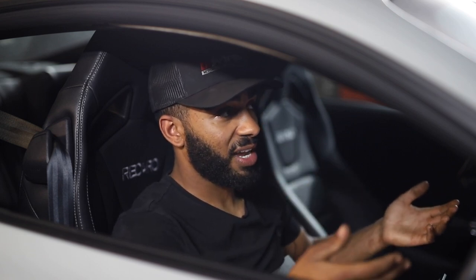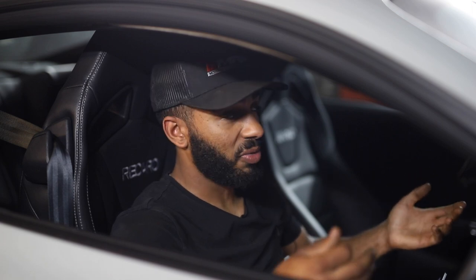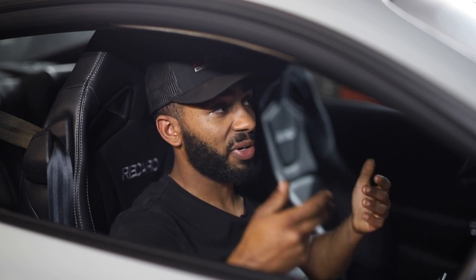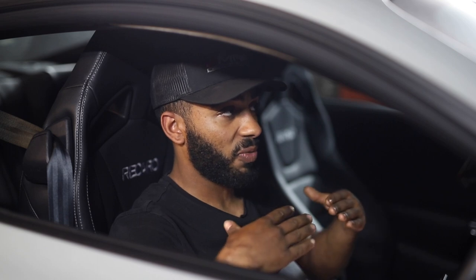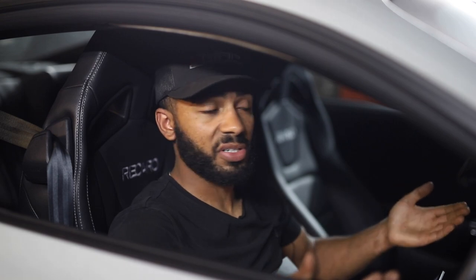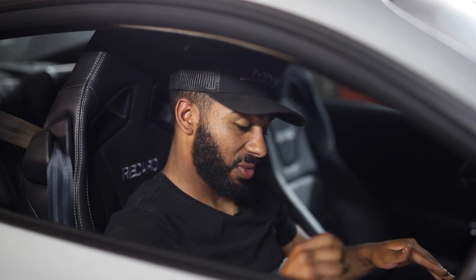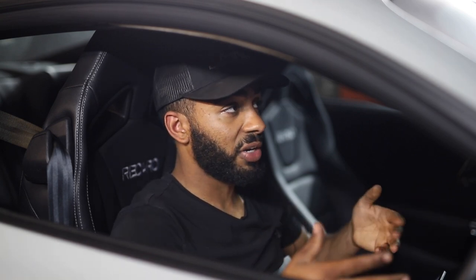With no hardware upgrades we're not aiming for higher peak numbers. The reason we're tuning these vehicles is that the torque curve is horrendous from stock. Anybody that's driven a Bullet or Mach 1 knows the bottom end just isn't there. Our software fixes that issue and gives you a nice flat torque curve like a modern V8 should. The logs are looking pretty spot on — we've got a little tweak to do top-end on the ignition timing, but other than that we can call this done.